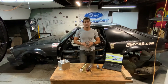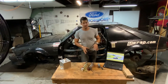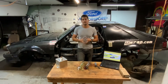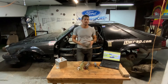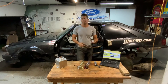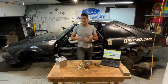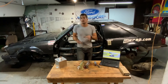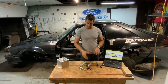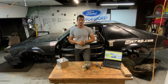I know a lot of people are going to ask why I don't go with a racing fuel cell. Right off the bat — money, and it's a lot of fabrication work. With racing fuel cells you have to get them inspected every couple of years. Between harness inspections, helmet inspections, window nets — all these parts have to be replaced periodically, it gets expensive. I didn't want to add another inspection item. So I believe between this performance hanger, the surge tank, and proper lines, I'm going to have zero fuel issues. That's it for now — stay tuned, much more to come.